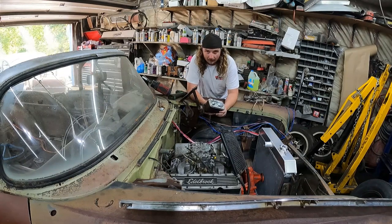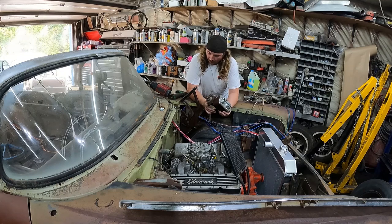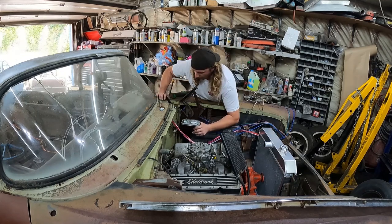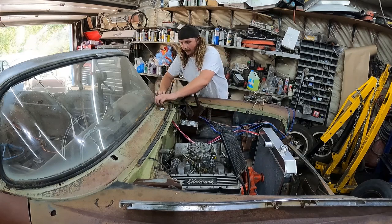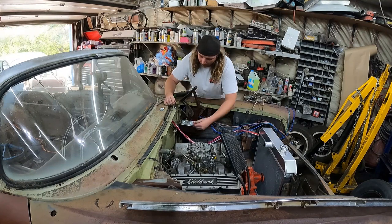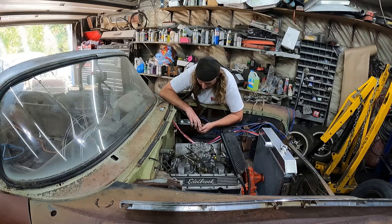The more modern brake master — we're talking 70s. Really all you've got to worry about is the bore size, which works out pretty good so the brakes have a good feel, and ultimately the depth. You have a fair bit of adjustment on these rods so it shouldn't be an issue. They are just two bolts. The hole fits in and bolts in just like that. Fine threads if you want to change the bolts or nuts — make sure you use the right stuff. I've done this on lots, there's no real issue.